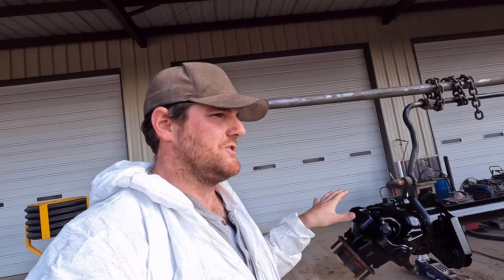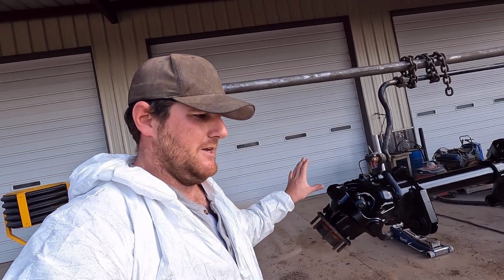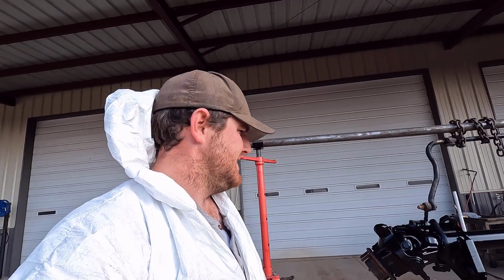So it's going to be a pretty special setup with this. We're doing a whole hub conversion. It'll have conventional bearings. It'll get rid of the unit bearing here. We'll go through all of that on the next episode, and on the rear axle we have to re-drill the hub. So we're going to be doing a lot of work on the axles, getting those to 8x6.5, but I think I have everything here so we can get started on it.